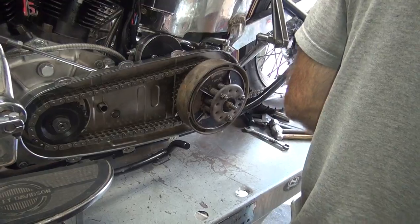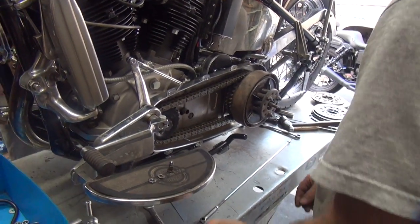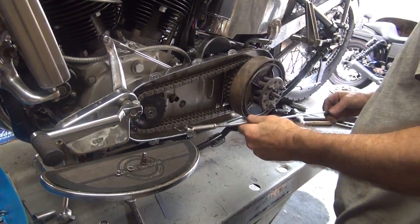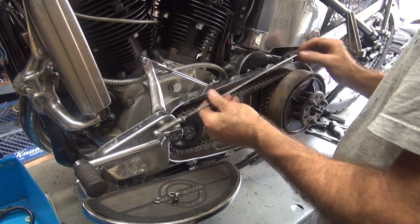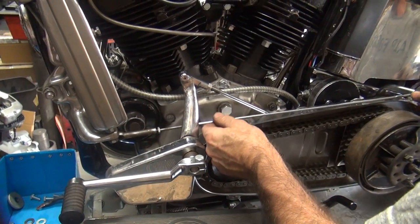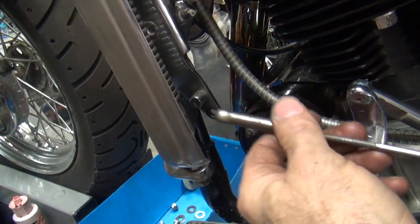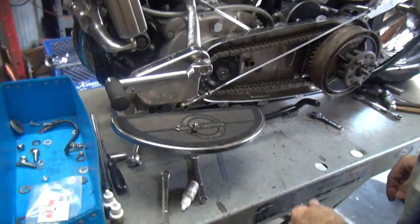We're going to get our clutch arm on here. I need a little crescent wrench to tighten this nut. This is our clutch rod for our mousetrap — we've got a little shoulder bolt that goes up in here. So this just slips in through the slot, I'm going to pull it forward. It looks like we were in front of it. There it was — there we go. In that position. Well, this little lever's been bent in if you look at it. So we've got to make sure it clears. I think what we need to do is move this out just slightly so it's not so close.